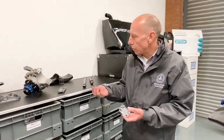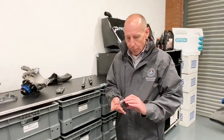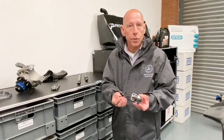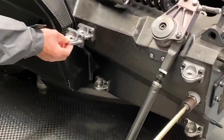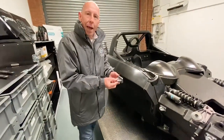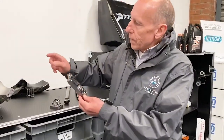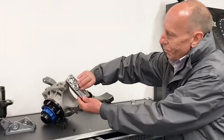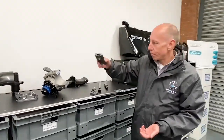The attention to detail is striking when you look at all these pieces — they're beautifully and sculpturally made. Because we're using the same size bearings and the same pickup points all around the car, cost-wise it's very efficient. This one pickup point is used all around the car — top, bottom, front, and rear suspension. Similarly, the same upright is used all the way around the car, with the bracket going on in any direction: left, right, front, and back. Brilliant idea — very simple but very cost-effective.